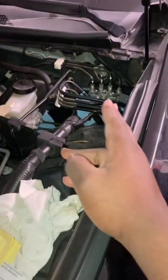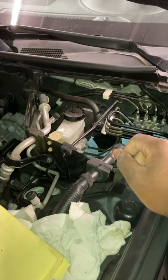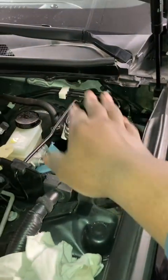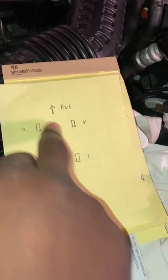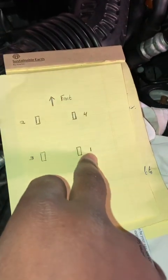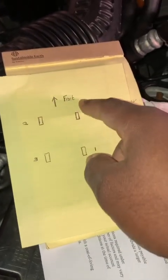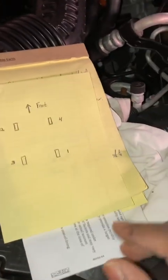The M45 actually had it labeled on the ABS module. This one doesn't label it here, but you can figure it out. When you do a brake bleed, you serve the circuits first. We're going to do circuit one — bleed this one, then bleed this one — farthest end first, so this one is farther from the front, bleed this then this. Then you come to do the second circuit: bleed this, then this one here. Usually, that should be it.